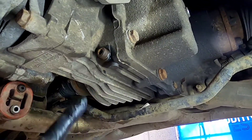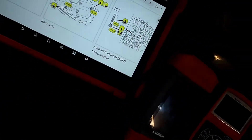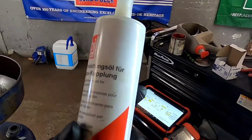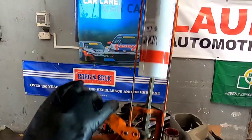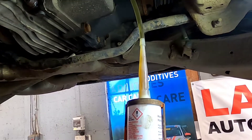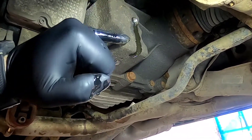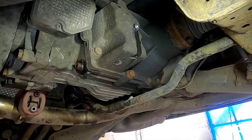Now I need to move around to putting the oil in. I've put the drain plug back in — that is torqued to 30 Nm as you can see — and we need to just fill it up now. It needs to pour out and then level off. We'll be using this oil; I've adapted the end of it just so I can bend it in with a little clear washer fluid pipe and we'll just get it pumped in. There we go, the oil is filled up — all I'm going to do now is just let it drain out until nothing else comes out and then we can get that bung torqued up to spec.